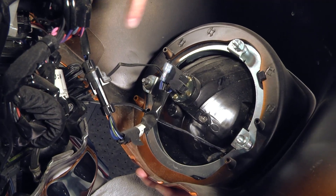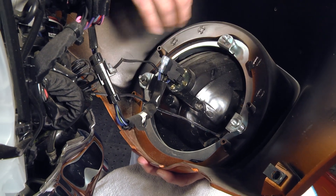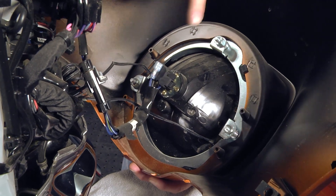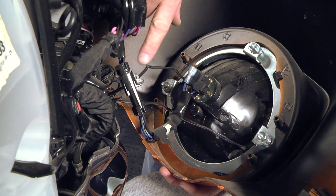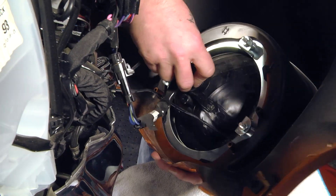The only thing left to do is unplug the headlight. On this 2014, your factory plug will look like this. We have an aftermarket headlight — a Rivera LED — which is why we have a couple of extra wires. On your stock one, you're just going to need to unplug the main plug. For us, we're going to unplug that and disconnect our extra wires and we're free.